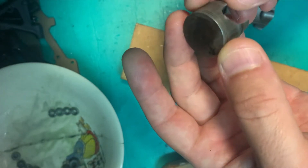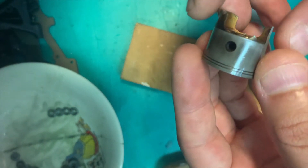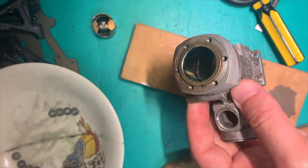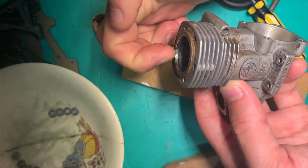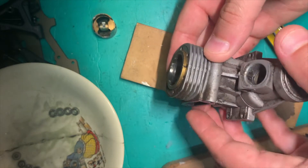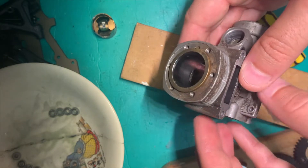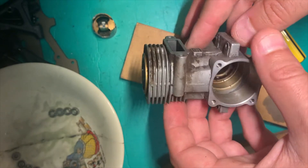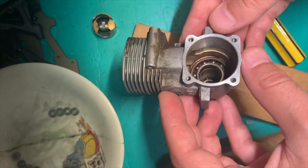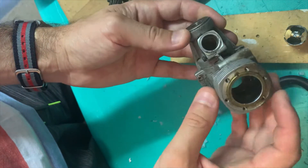It's all cracked. Definitely there's a bit of con rod remaining on there, and we've got some big scratching on the piston. So all of this is trash. It looks like there's some big gouges in there — even here as well. So we're not going to use this. We'll get that sleeve out and see if the case is still good — I suspect the case is still really good. There are lots of fragments of metal in there, so we're going to have to clean those out.